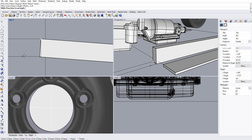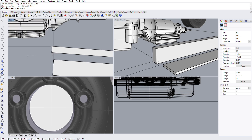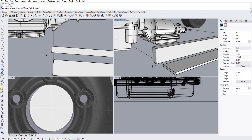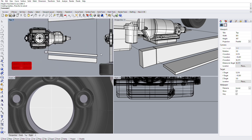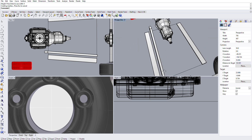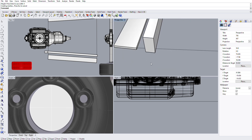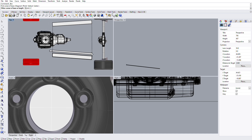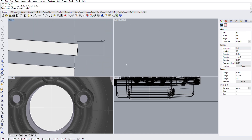We're essentially establishing where we want the frame to be. We're only going to work on one side for now because I can mirror it off a known center line to get the second side. When you type in a value and your cursor is below it runs below; move the cursor above and type a negative number if needed. I've been doing this for years and I mess it up all the time — I had to take a few retakes in this video.